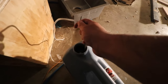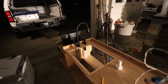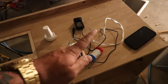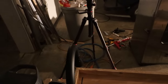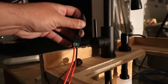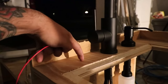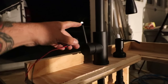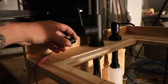That will sit inside the water jug. I do need to connect a hose to this end and then that hose will run to the faucet. So this is going to be my on/off switch for the water pump. I'll flip it on, that will bring water from the jug over to the faucet, and then I'll open the faucet for water to come out. Off camera I'm just getting all the wiring done for the water pump. I decided to put the on/off switch here, so the switch for the pump and the faucet are all in the same spot. Let's drill this hole and then solder the wires together.